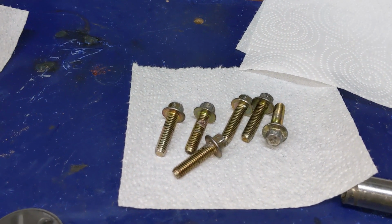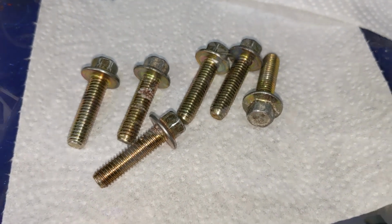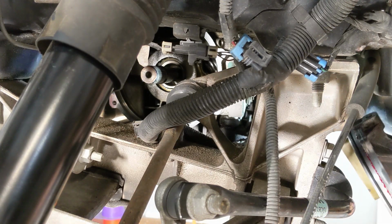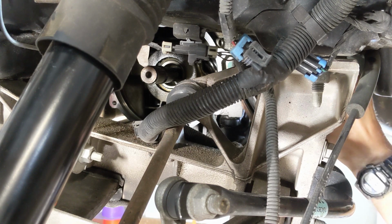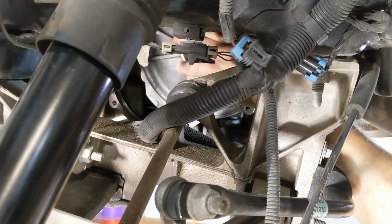Now, before we go ahead and install the cover, make sure your bolts are nice and clean. Don't put some greasy, grimy bolts back in. For the cover, this is the moment of truth. Get situated comfortably where you can manipulate each arm. Slowly move the cover into position. If for any reason you hit the anaerobic sealer on anything, take and clean off that part and redo it.